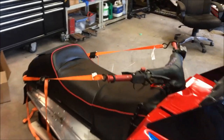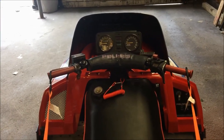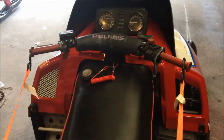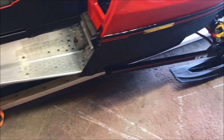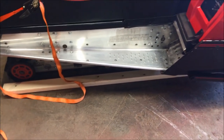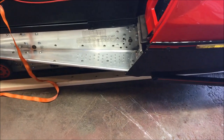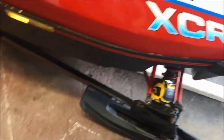This is the setup you're going to be working with. First thing you need to do is get your handlebars straight. Then you're going to take a couple of ratchet straps and position them so the bars are not going to move as you're working on it. Once that's squared away, take an eight or ten foot two-by-four — find the straightest one you can, it can't be bowed or have a significant crown. Lay it flat against the track so it has as much contact surface as possible, running all the way up to the point of the ski.